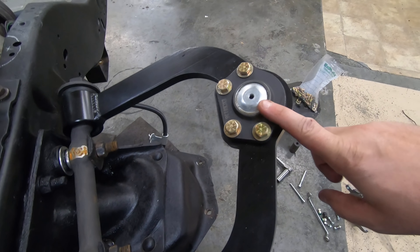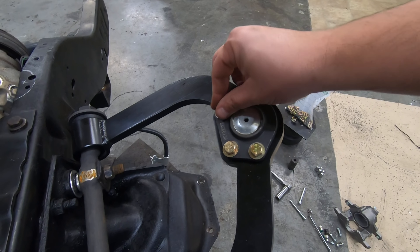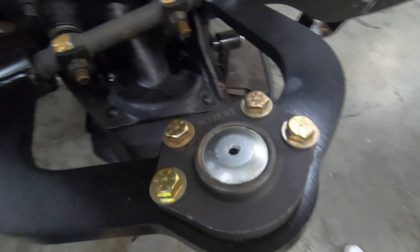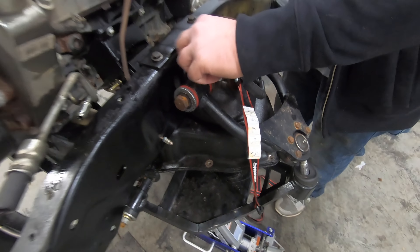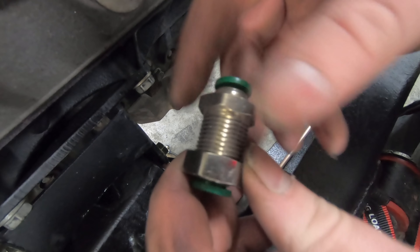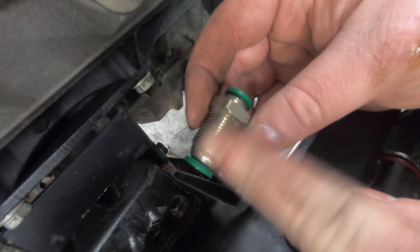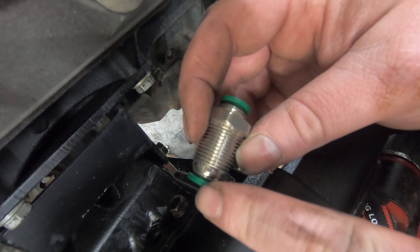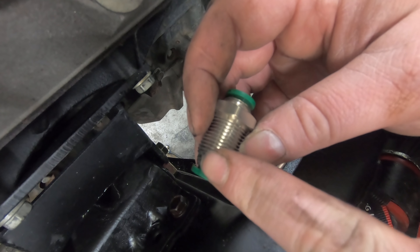When we were putting this together for the C10 Fall Revival, the bolts were too short on the ball joint. Mike got us some grade eight hardware to put in there and got that all cinched down — just another thing checked off the list. We're still waiting on the control arm to come back from Michigan Metalworks, so we're still using this DJM arm. This bulkhead fitting is designed to go through a piece of metal. Normally people run a line through a frame and put a grommet on it or some kind of protector to keep the line from getting abraded. You just put this in there, get a little nut on it, tighten it down, run your line into one end, line out the other end — nice, clean install.